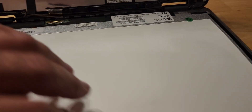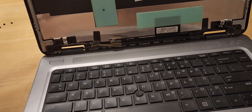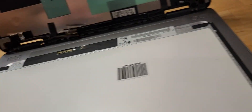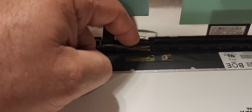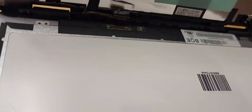Now I'm going to take out my broken screen. When you do this, if you've got the 768 display, make sure you buy the replacement screen with the 768 display — you can't use this as an opportunity to upgrade your display if you don't have full HD; you can't go to full HD. I'm going to put the new screen down face down, which will allow me to line it up nicely and snap it into place.